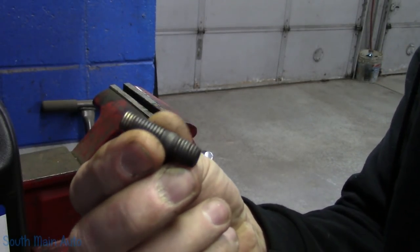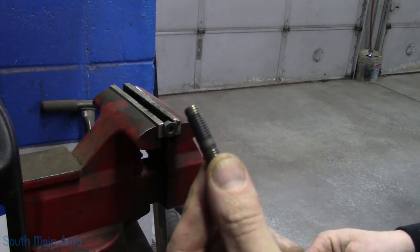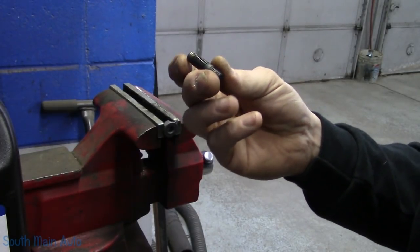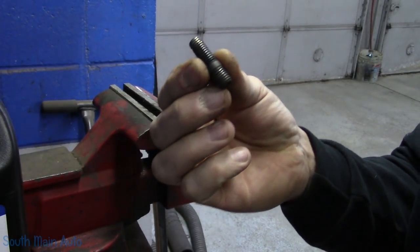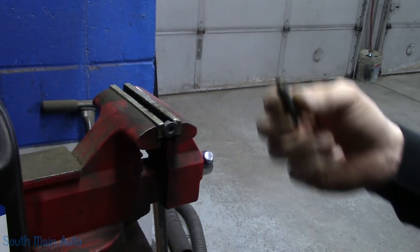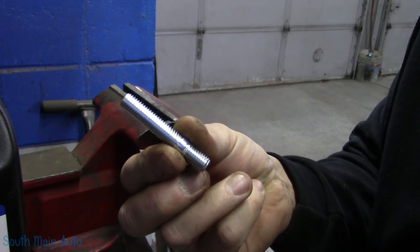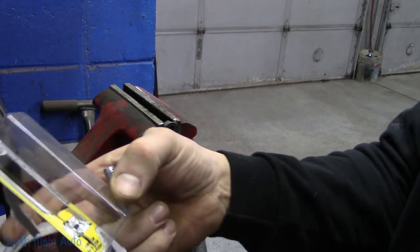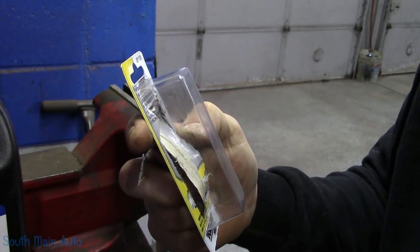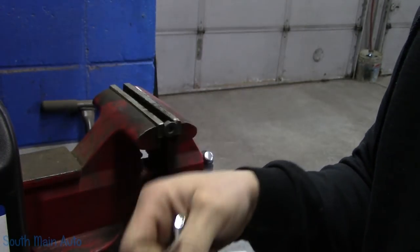These do not exist in Western New York on a Sunday afternoon. Oddly enough, Tractor Supply and their giant Hillman fastener selection — they do not carry a single stud in the entire store. I got these from Advance Auto. These are just made by Dorman. There's the part number — it's a universal exhaust flange hardware kit. They are the correct size, M10-1.50.